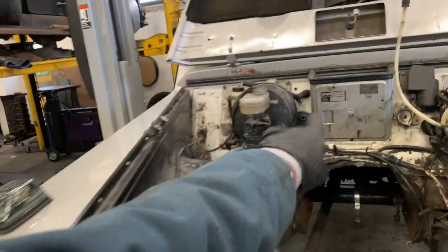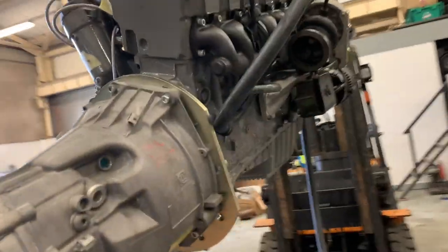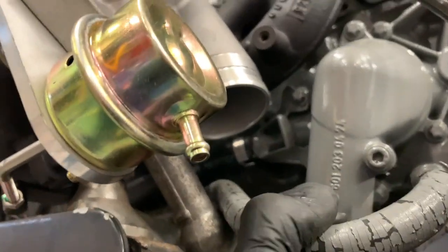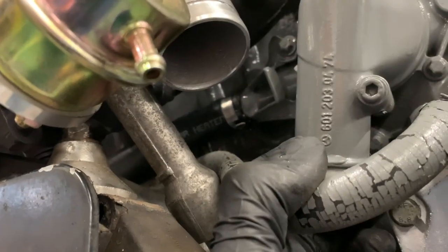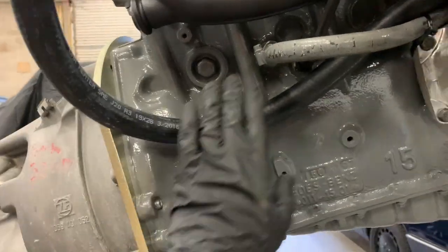Little basic update. Just showing you, I did have the coolant pipe connected directly to the water thermostat. I've actually changed that. I'm just going to mount it directly to here, to the actual pipe on the back of the thermostat housing. Apologies for the paint not sticking on the rubber pipe on there, because it's quite hard to get to when the engine is in the car. So it's better to mount that there. Also, pop your P-clip on your block as well to keep that pipe down.